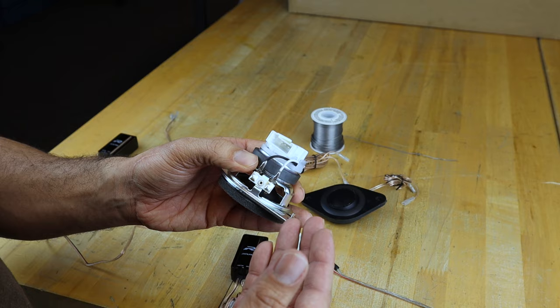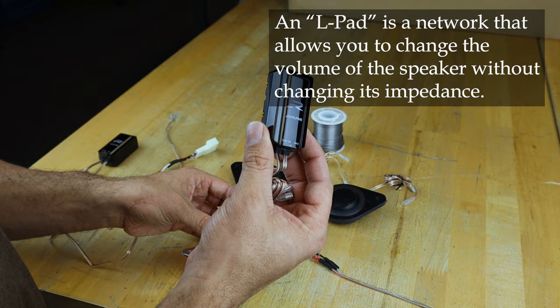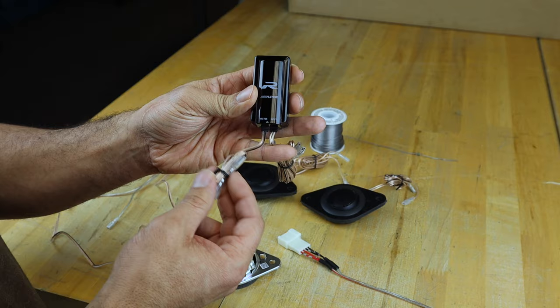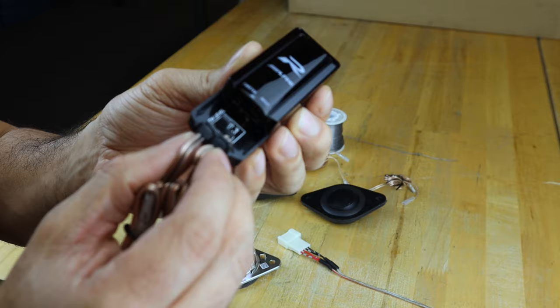If your tweeter is too loud or too low you may have to figure out other ways of adjusting the volume — you might have to install an L-pad and that's just work I don't want to do. With these external crossovers like the ones that come with the component system, you feed it the full signal from your head unit and the crossover feeds the filtered signal to the tweeter. The beautiful thing is you can slide them and adjust: plus 3 decibels, baseline 0 decibels, or negative 3 decibels, so you can tweak it exactly to your liking so your highs are not overpowering your system.